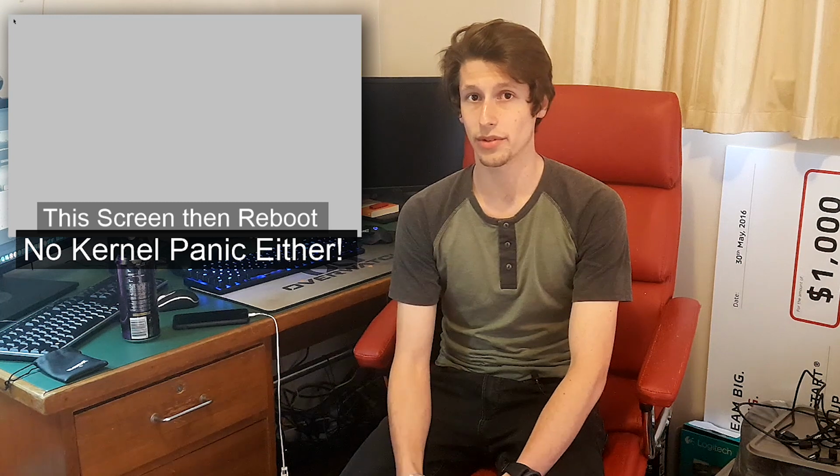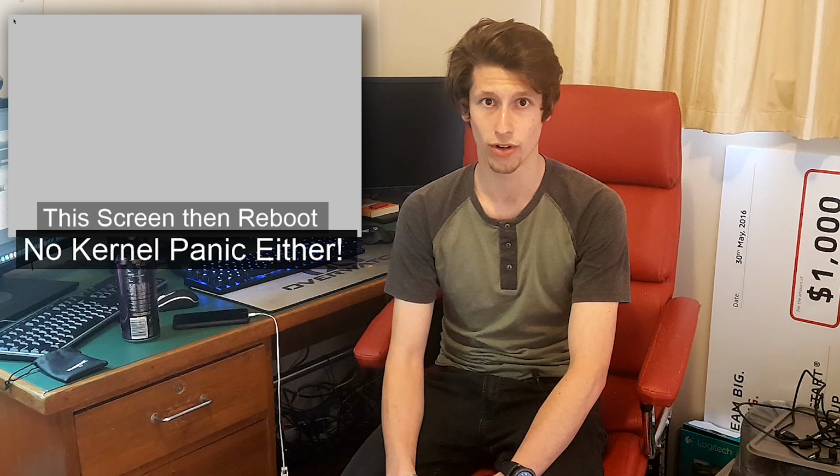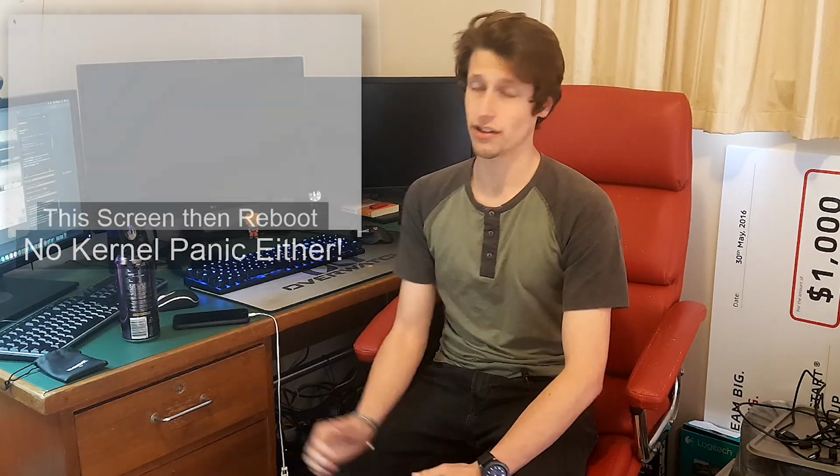So, what I ended up doing was a bit of research and found out it was SSE 4.2 support on the CPU. Now, this machine runs a Core 2 Duo E7500, and that is a bit old now. It's not super powerful, but it does, unfortunately, not support SSE 4.2. So at that point, I could have given up, rolled back to High Sierra, and continued using that happily.